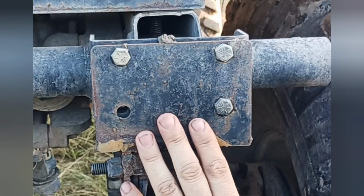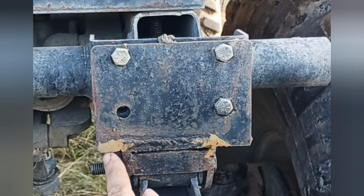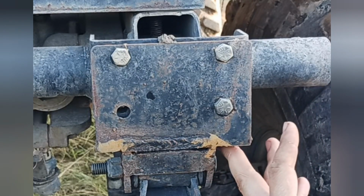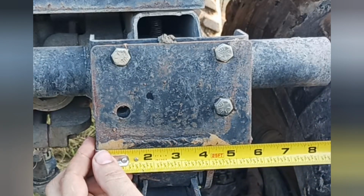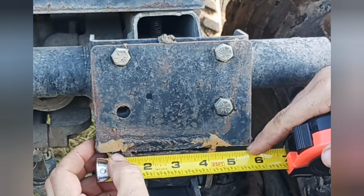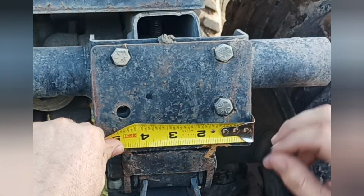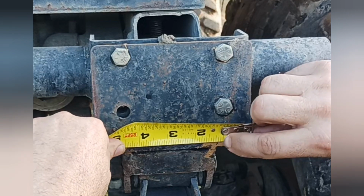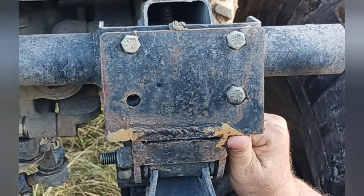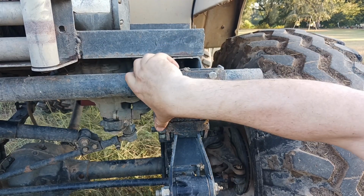Whenever you go to build this Max Anthony kit, this Climax kit, just know this. This flat plate and the bottom flat plate are cut off center. You see here it's 5.5 inches here, and 1 inch on this side, and an inch right there, and a half on this side. This side's longer than this side. You can tell just by my thumb.